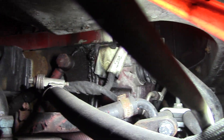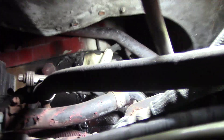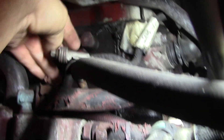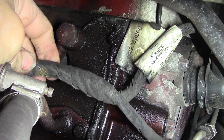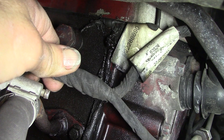As you can see, someone goo'd up the back cover here when they did the cylinder head. I had this harness a little bit better tied up. It's right behind this hose clamp here where my thumb is — that's my issue right there. It's rubbing on the cooling pipe coming out of the compressor. I'll have to repair this and secure this better.